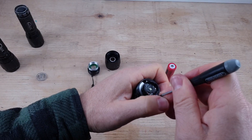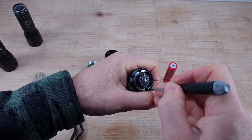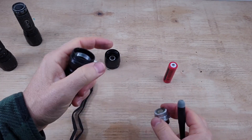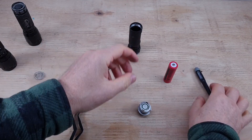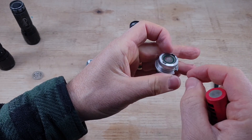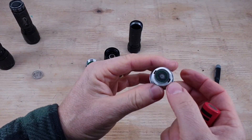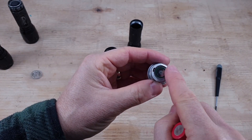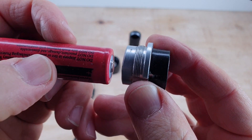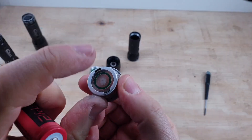This one's been out before, but they're not too hard to undo. There's two slots - just get something in there, and if you haven't got a pair of circlip pliers, two screwdrivers will do it. That's the shoulder we've got to grind down. This is the problem - this pin doesn't make good contact with this surface here because there's a shoulder, so we're just going to simply grind that down. I'm going to put it on a belt grinder, but you could use anything really - a file. Just stay away from this surface; it's just this shoulder you're interested in. I've ground that down now. I haven't taken it all the way - still want a bit of a shoulder there - but as you can see, there's a nice gap there now so that our centre pin's going to make good contact with that.